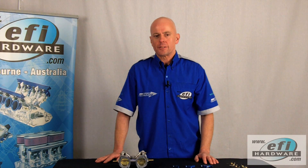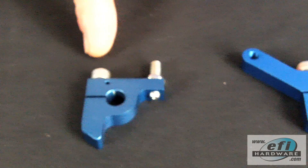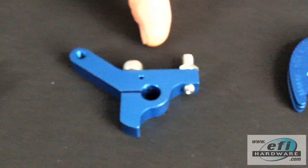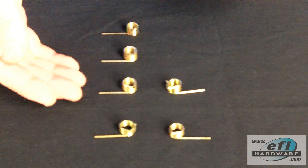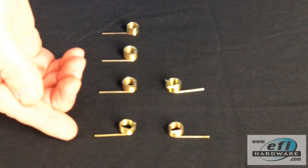There are a variety of different linkages that incorporate a throttle stop within them. Here we've got an example of one standard throttle stop, one with a lever arm, and one that incorporates an eccentric cable pull. There's a great variety of springs too, in clockwise and counterclockwise — extra light, light, standard, and heavy duty tension.